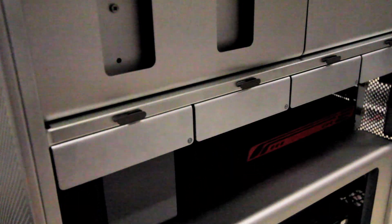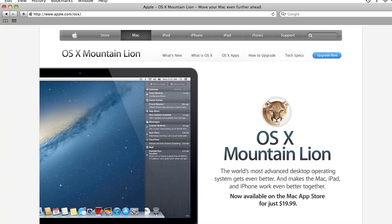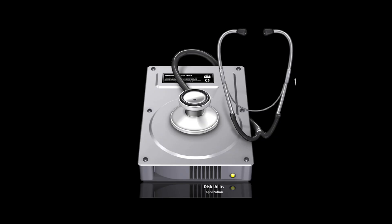You are now ready to install Mac OS X on your Ramjet SSD. Boot your machine using the Mac OS X DVD, USB stick, or use the online procedure to obtain Lion or Mountain Lion from the App Store. Once the machine is finished booting, go to the Utilities menu at the top of the screen and select Disk Utility. Select the SSD drive from the drives listed on the right and choose Erase. This will format your Ramjet SSD for use in your Mac Pro.